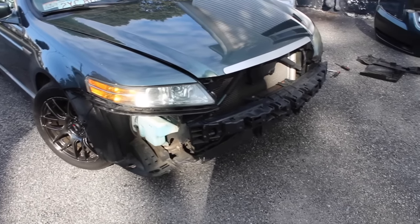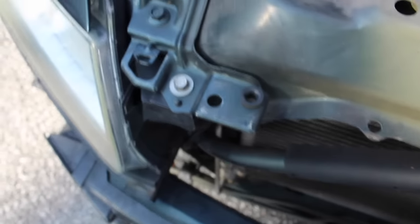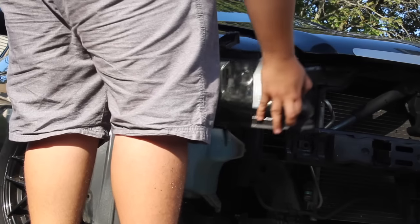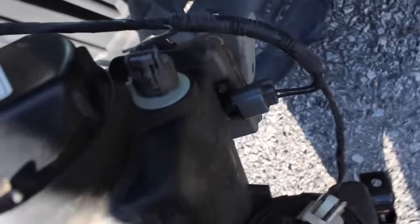20 minutes later, this is what you should have. If I peek under, that's the ballast I'm going to change. You're going to loosen up some of these screws — this one, this bolt 10 millimeter, one right here, and two up on the hood. That should free up the headlight. You are going to unclip the wiring harness — right there, right there, right there, and right there.